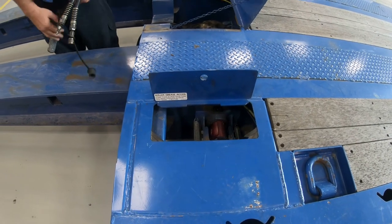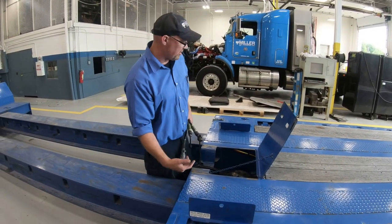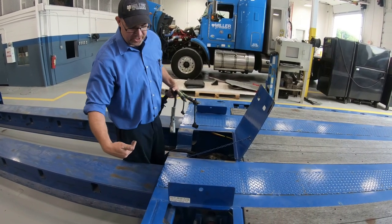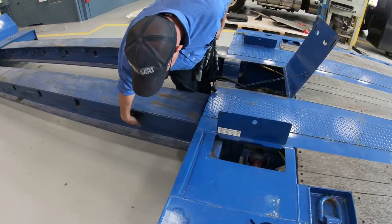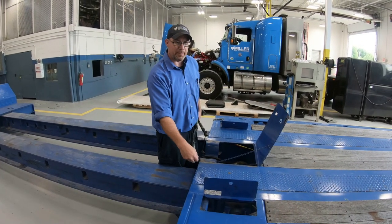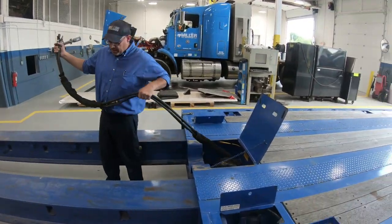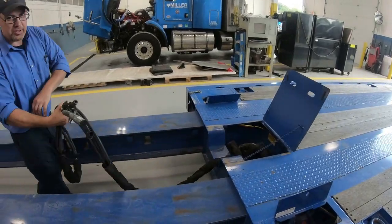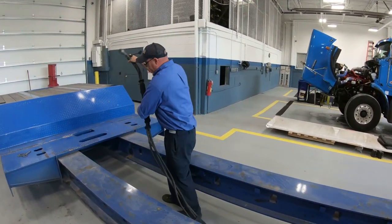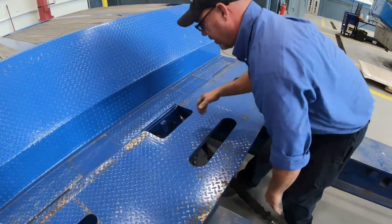Now that we have the trailer stretched out, you're going to find one of these notches along here. When you get close to the point you want to be stretched at, you take the switch and switch the lock — these will automatically return. Then you just move the trailer back and forth until you find the positive lock that goes in there. Make sure they're both engaged. Drop your safety pin in there with the cotter pin on the bottom. Now you take these lines — once again we put them in here — so pull them out. This is one cord whether you're stretched out 2 feet or 15 feet, same cord. You run it through this little hanger here and hook it up just like we unhooked it.